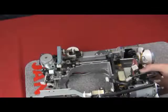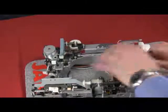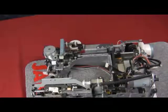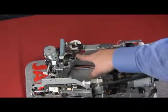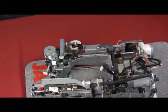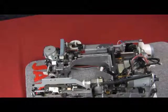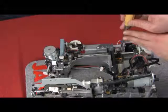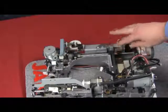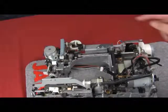Next, lay the machine down and get the wires out of the way. We have a black plate on both sides to cover the left bushing and the rear bushing. We also have our shield plate — it's very important to loosen the shield plate. There's a 2mm hex screw. If we don't loosen this before removing the shaft, it very possibly could break into the sensor. Once it's loosened, you can just leave it on the shaft.